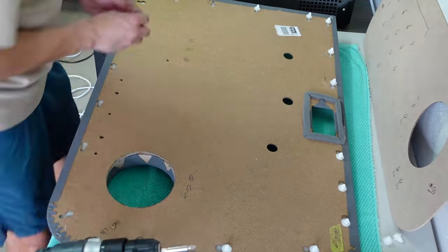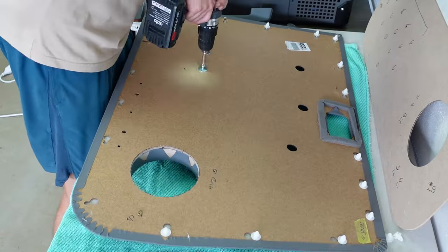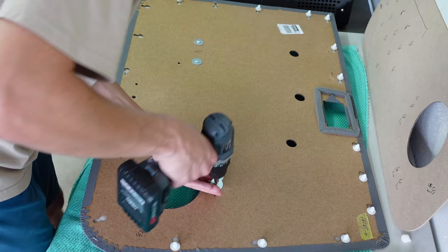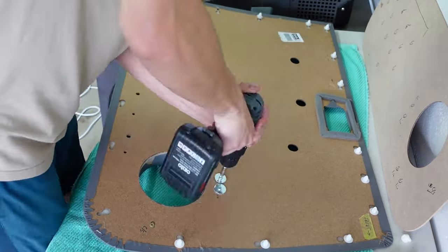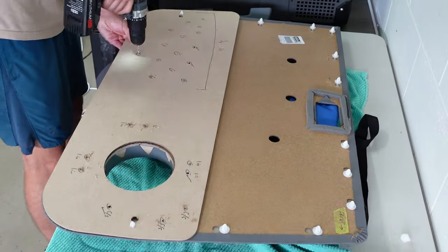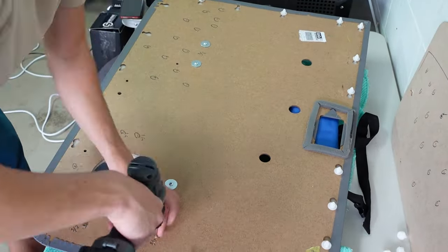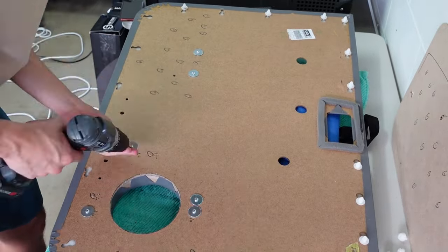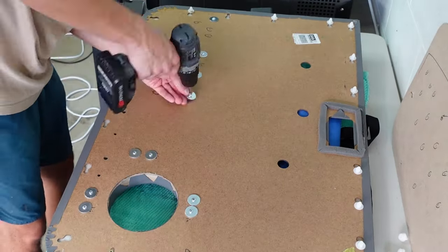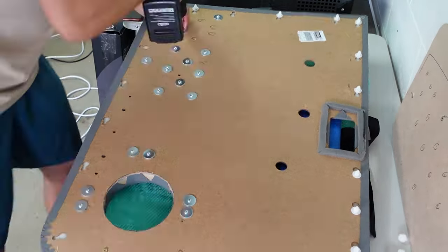I screwed in the initial mounting screws to align the door pods and then flipped the card over to make sure it looks as it should. There are instructions online with the Department of the Interior that have clearances you can check. I pre-drilled the remaining holes and screwed in the recommended screws to attach the door pod to the door card. Please note that I accidentally went too far with the drill bit once and went out the other side of the door pod — I recommend setting a depth limit on your drill bit or wrapping a piece of tape a few centimetres up the bit to avoid this. I'm not an expert nor would I even qualify as mechanically minded, so I do make mistakes. But at least you will learn from mine so you don't repeat them.